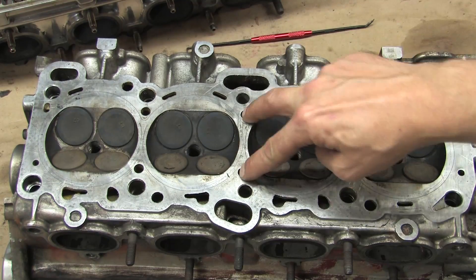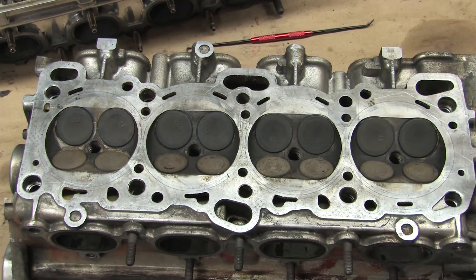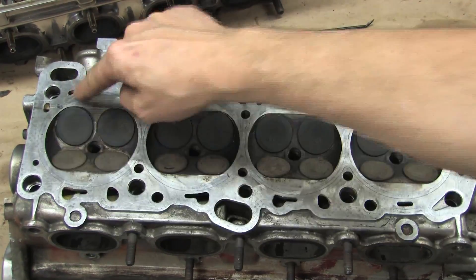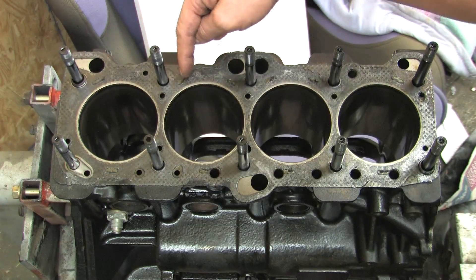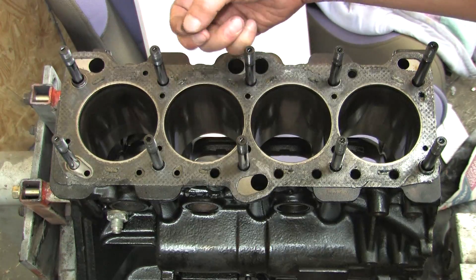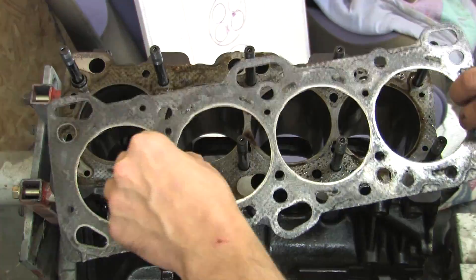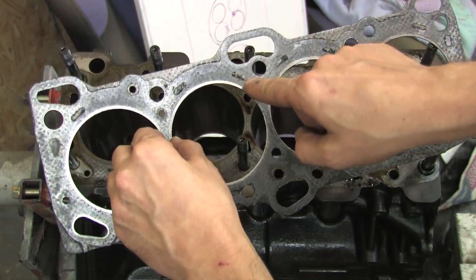All the rest of the holes except for one are coolant passages, and there's something you should note about those too. Most all of the slotted holes in the head are blocked off by the gasket. Do not make cutouts in your gasket for the blocked head ports — you'll find when you place it on the block that there's no provision for those holes on the block either. A few of them do pass through to a round hole.